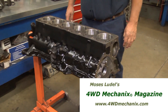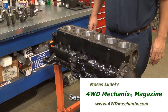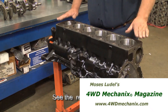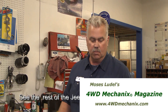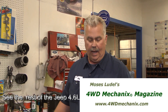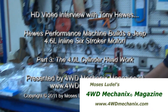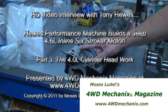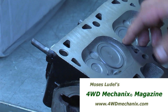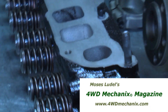Let's begin with the block, Tony. I know that this started out as basically a four-liter engine. You got a four-liter Jeep core, and there are many ways to go on how to achieve the four-six-liter deal. We can segue into the cylinder head — if you look at the cylinder head here and see this is what's considered the quench area of the cylinder head, over here is the combustion chamber. The six cylinders have the intake and exhaust port on the same side.